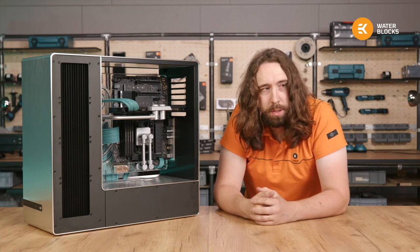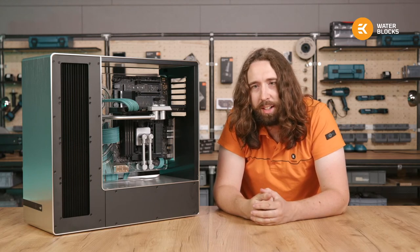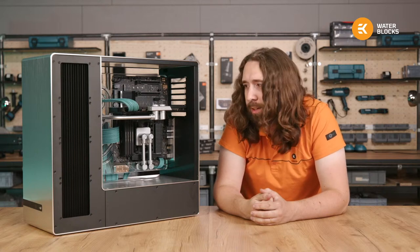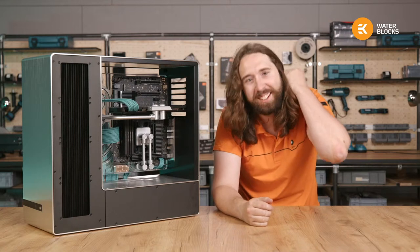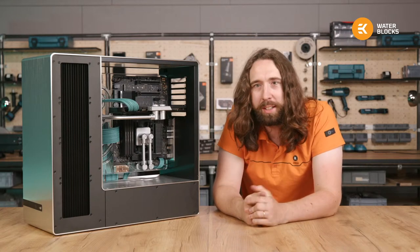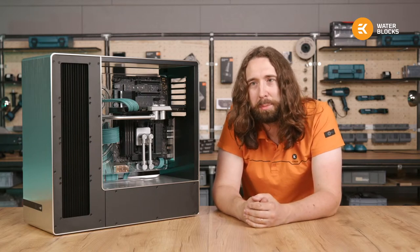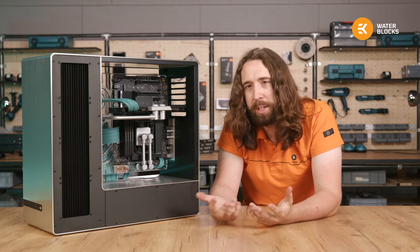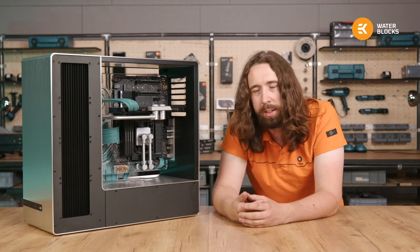Yeah, so much work in the 24 pin. I can't wait for the ATX 12V0 spec to kick off, and we can just make a simple 10 pin and one wire to turn it on. All of the 5V and 3.3V and -5V rails that aren't really used anymore make so much extra work.